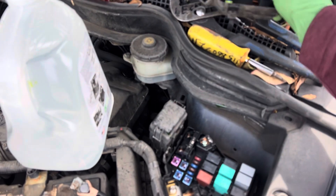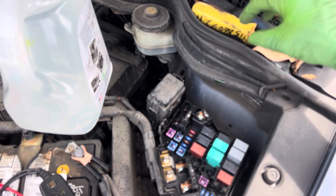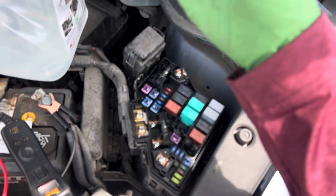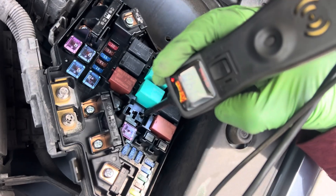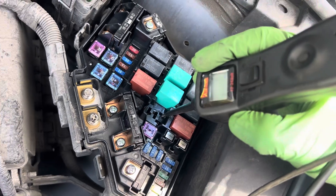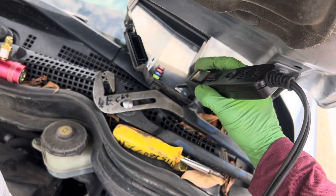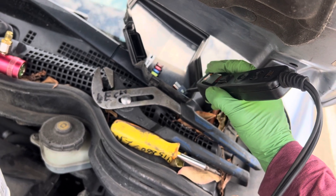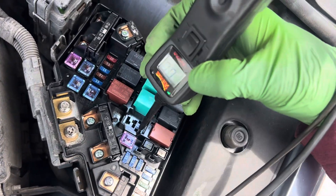So we come over here and take a quick shortcut without looking up any books. I go clicky clicky — nothing happens. Break out the power probe. We got 14 volts right there. So that is for the coil and that gave us our clicky clicky. Those little tiny terminals have just a little bit of current — that's to activate the electromagnet inside to make the points engage, with the ground on the other side.